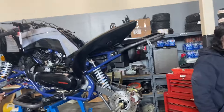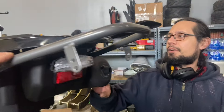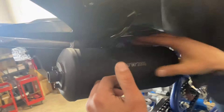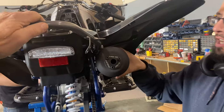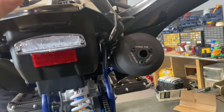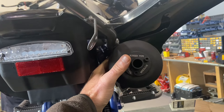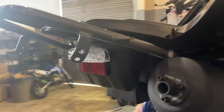Marcus is in the process of installing the rear rack. On the Pintura 150, two bolts are behind the exhaust, so you need to remove the bolt holding down the exhaust to get to them. Make sure you reinstall the exhaust before you tighten those bolts, otherwise it's going to jam up the exhaust. To install the rack properly, loosen the exhaust muffler, drop it down a little, mount it, and secure the bolt. Use a hand ratchet to tighten those two bolts.